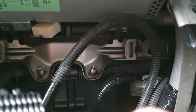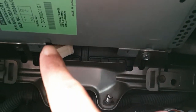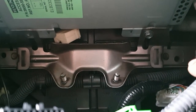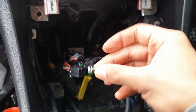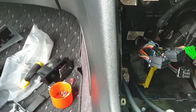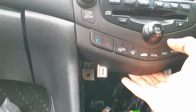To take this off we have to come underneath here. It's a bit hard to see but there's normally two bolts — one there and one there — well, one's missing so we'll take that one out and pull out the top unit. This bolt is just an 8mm head, so if you have a small tool kit like this it's very easy to work on any car. You will have two of them if your vehicle's never been touched.